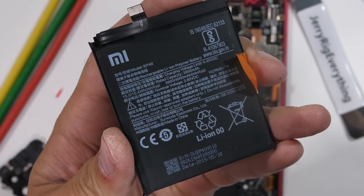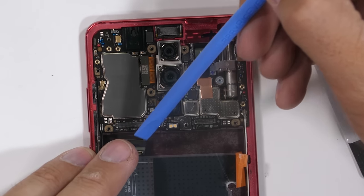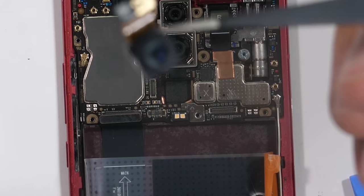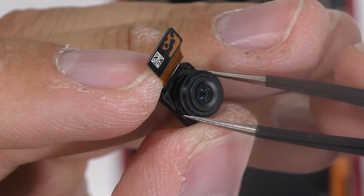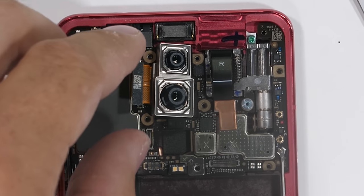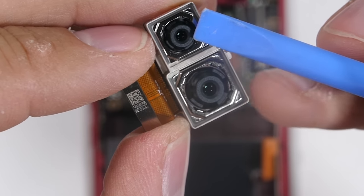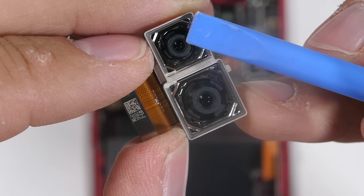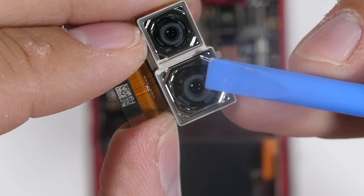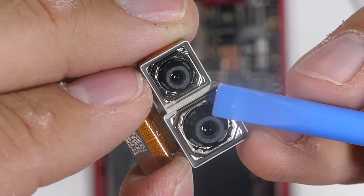The battery is a 4000 mAh capacity. I can unplug the bottom motherboard ribbon and the lowest camera, the 13 megapixel wide angle. Pulling this guy out to get a closer look reveals that there is no optical image stabilization. We can pop out the other two rear-facing cameras out of the housing — the top 8 megapixel telephoto camera and the middle normal perspective 48 megapixel Sony sensor. Neither of which have physical image stabilization, but this budget phone is extremely feature-rich at around $350, so we can't complain too much.